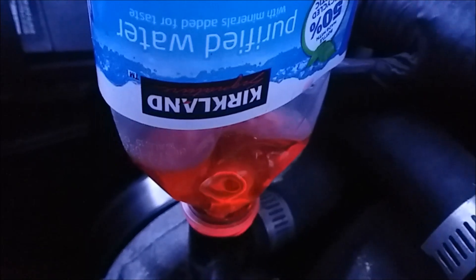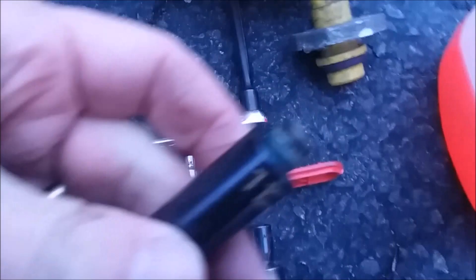You do not want the fluid to go down so far that it sucks air back in through here — just give it a real slight tap. I'm trying to get the last of those air bubbles out. RPMs can sit at around 2,000; they don't need to be much higher than that. I still see some air coming through but it's getting close. I've just got my hand on the accelerator cable — we're going to let it off and let those last couple bubbles come out.